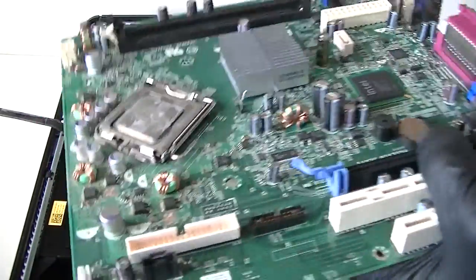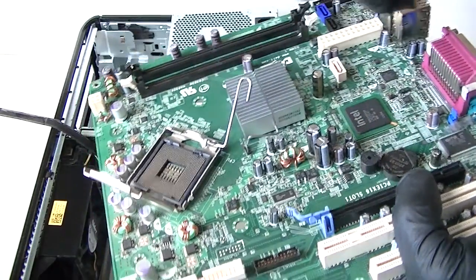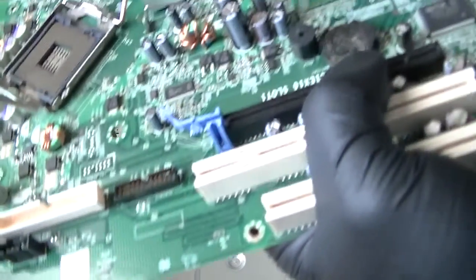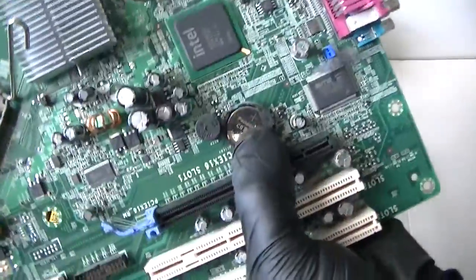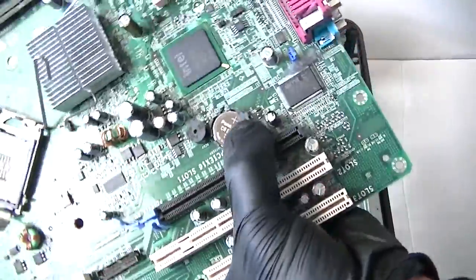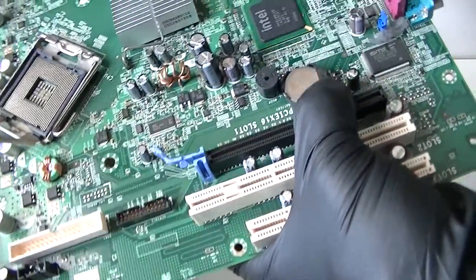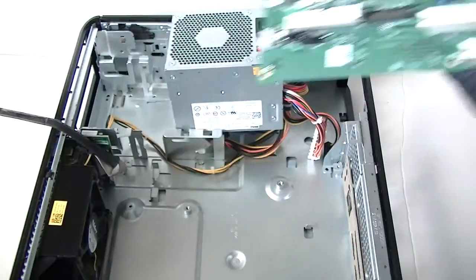Here's the motherboard. If you want, you can remove the battery too. Use the processor — remove that; it's like an LGA 775. To remove the battery, use a flat head screwdriver right here like this and it comes right off. There's a secure lock right here — you press the little clip and it removes the battery. I'm going to leave the battery on for now.